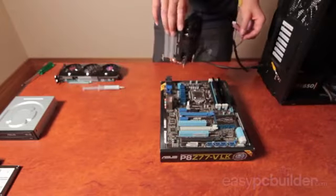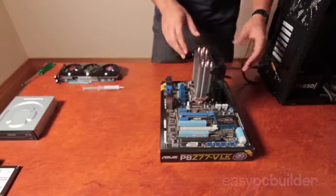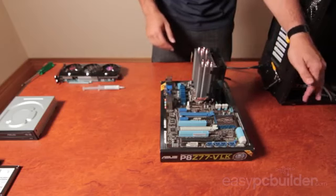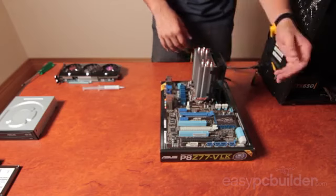So now it's time to figure out what orientation is best for our CPU cooler. The fan intake's through the front of the case, so we've got our bottom of the case here and the back here. And what we want is for the air to draw in through the front, exhausting out the back and top fans of our case.